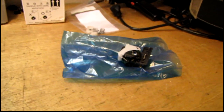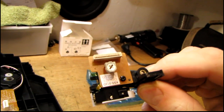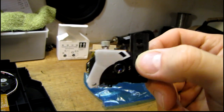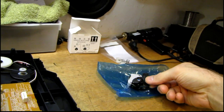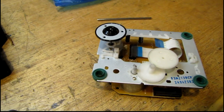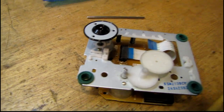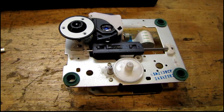The laser I'm assuming went bad just from age. You can go on eBay and find a new laser unit for about ten bucks. This is a KSS 213D Sony optical pickup. I think it's the same as a KSS 213C except this one has a dust cover that automatically covers the lens when it's in the home position. I'm not positive it's electrically interchangeable, but anyway it's already taken apart and I'm going to show some of the reassembly.